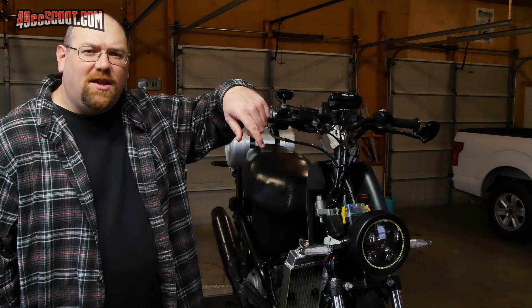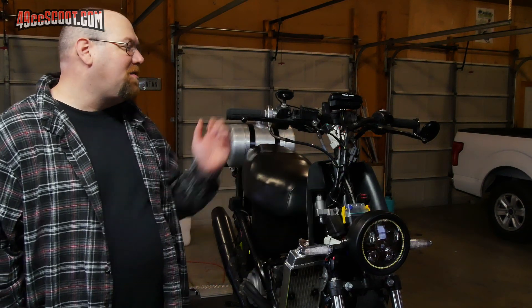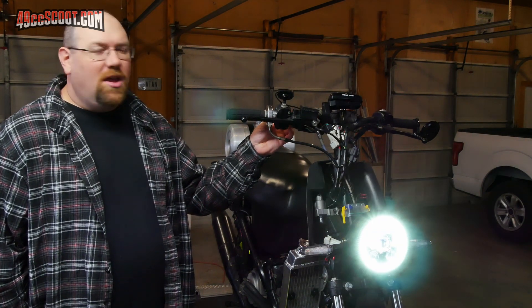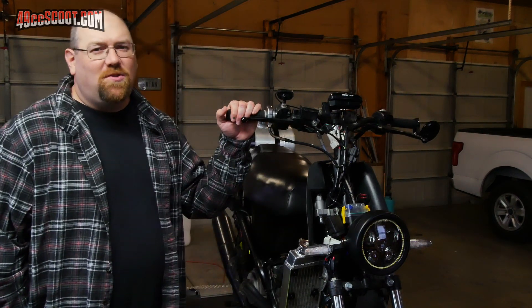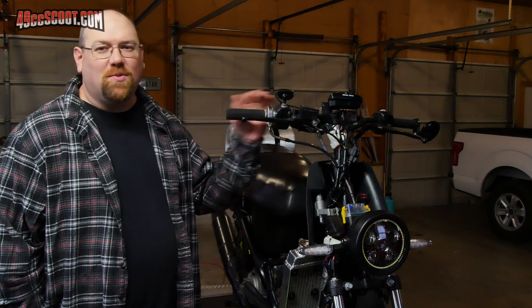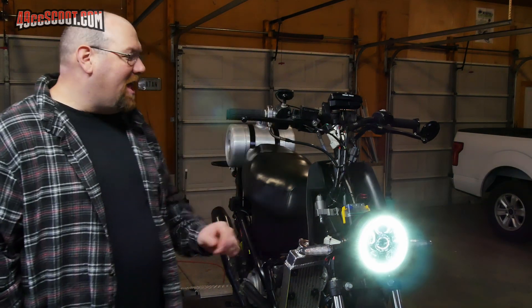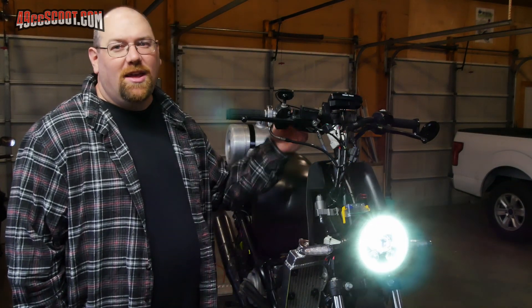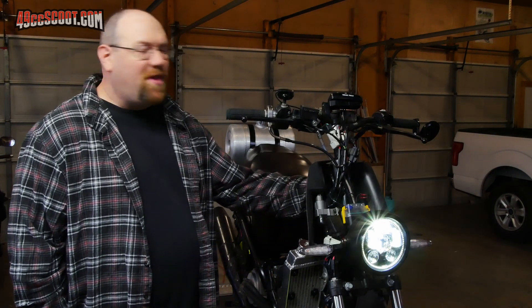While I was at it, I also decided it would be a good idea to install a switch for the DRL itself. I was initially hoping I could just use the parking light function and the headlight function, but for two reasons — one, to lower the output, and two, because I'm not sure other drivers will appreciate this really bright halo at nighttime — I added another switch in line so I can turn the halo on and off independently, and use my low or high beam without the halo on.